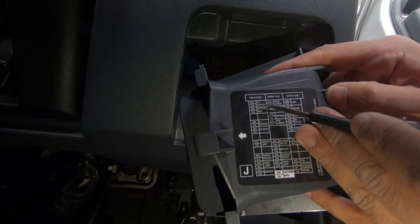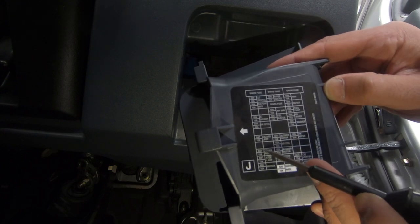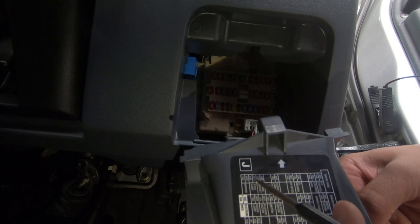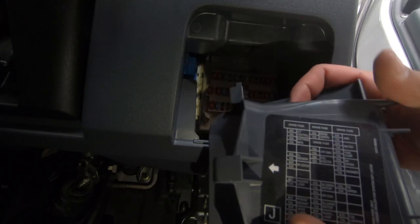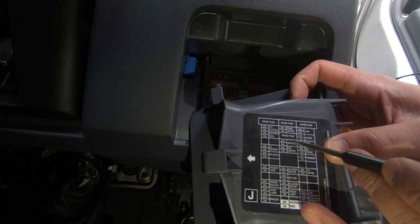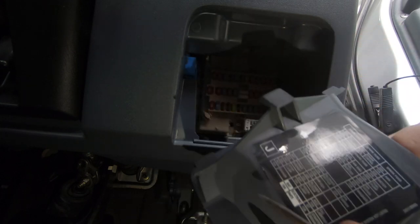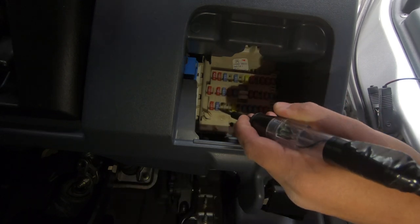Automatic control — no way. Electronic parts — no way. O2 sensor — no way. Power socket, battery, 15 amp — so we have a power socket with battery power. That's three fuses up, a 15 amp — we can use that for battery or constant power. For ignition power, stay right away from the airbag. We want the cigarette lighter — that's a 15 amp cigarette lighter fuse. That's the one we're going to go for.